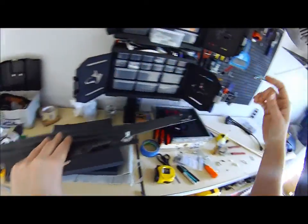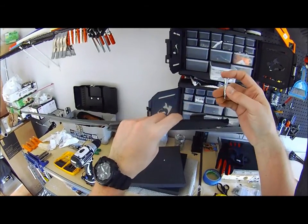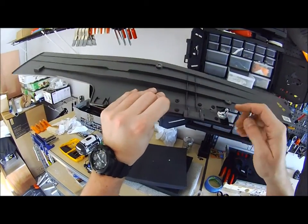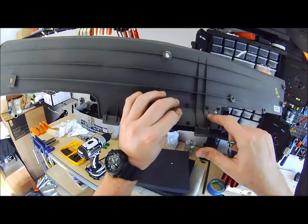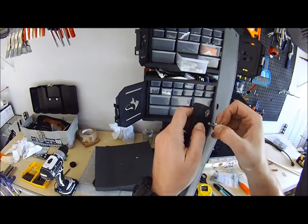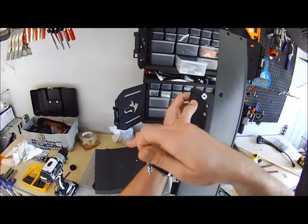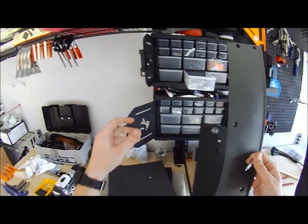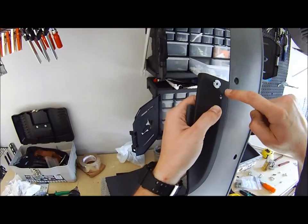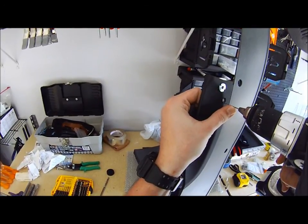Like I said, this plastic is too thin. These anchors need about this much material to bite into; otherwise when it folds over it's not going to have anything to fold up against and it'll be rough. So adding the plastic piece was perfect. I'm putting these anchors into the hard plastic piece, and since it's so hard they're not going to get a bite like the foam-and-skin panel. So whenever I push these in, I drill two small pilot dots with a 1/16-inch bit first.